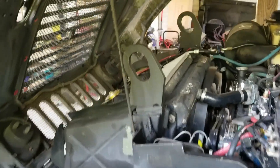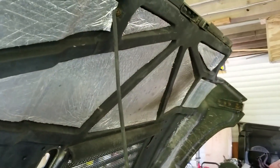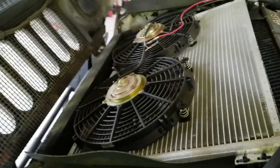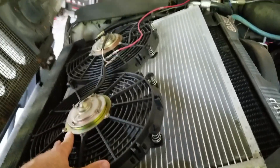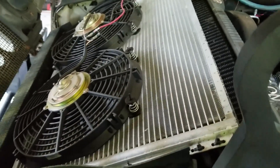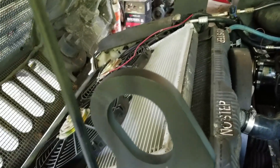This is the engine. I have insulation under the hood to help with engine noise, and I've got new hoses and new belts. This is the AC — these fans come on when you turn the AC on. That's the Coldmaster kit that I got, that's how it runs. I like having the condenser on top of the cooling stack here like the H1s have. It keeps it out of the way, you don't have to cut anything on the body, and everything stays cool and works.